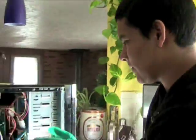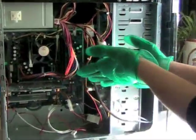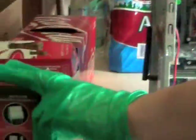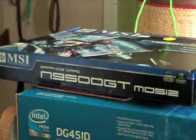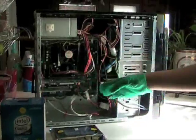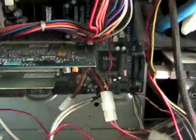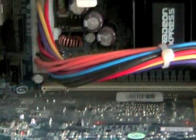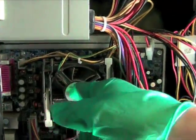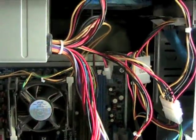Hi, I'm Keon. Today I am replacing this motherboard with a new Core 2 Duo motherboard, and we're going to replace the power supply, the video card, this motherboard, and this processor, as well as a hard drive. This is what it looks like inside — as you can see, it's really dirty in there. Apparently it overheats when we play World of Warcraft, and there's only a 40 gig hard drive and an older GeForce card in there. It's a socket 478 P4 CPU, so let's get started.